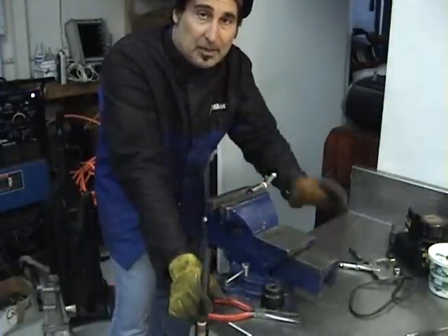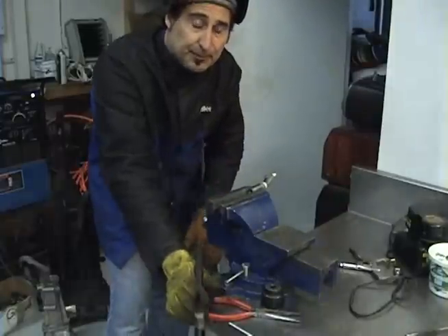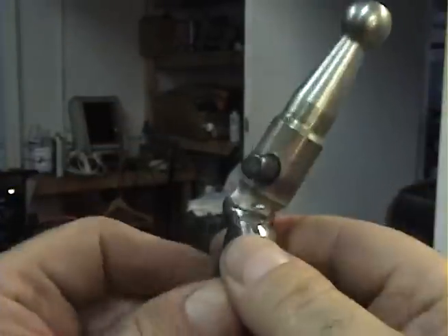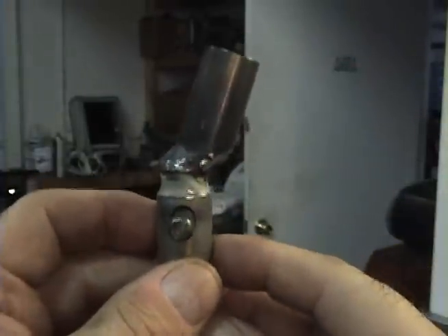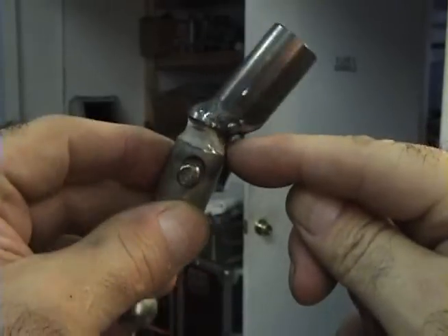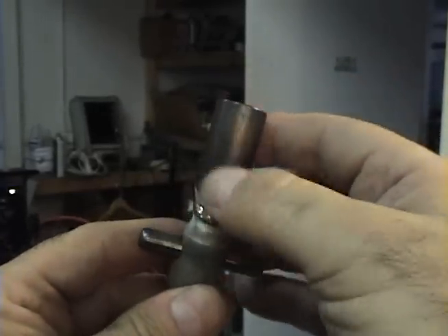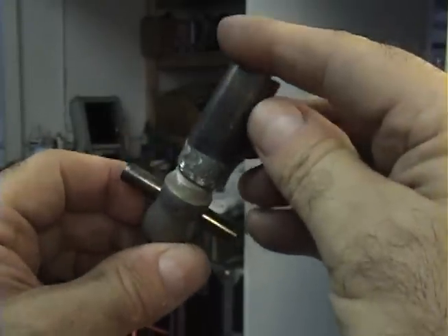We're done welding now. I'll let it cool down, do a little grinding work, and then put it back in the shifter body. You can see there's a nice fillet weld in the front. On the back side I ground quite a bit of the weld away, but I've built it up — the reason is that when it's in the shifter and tilts, it'll still clear the shifter body, and that's about all the movement needed. It's still very strong. I clean up and smooth the edges so you can't cut the rubber boot when it goes over it. Now I'll stick it inside the body and fuse weld the whole thing together.